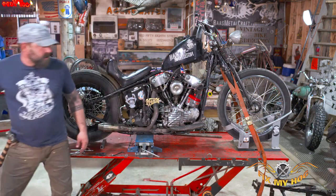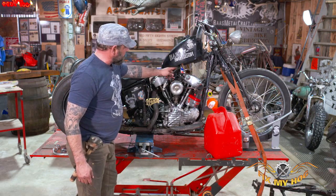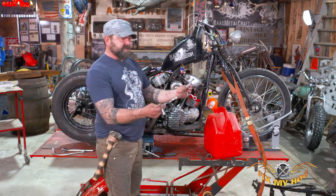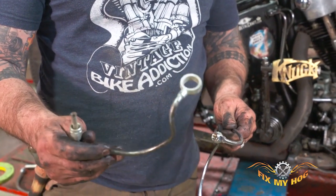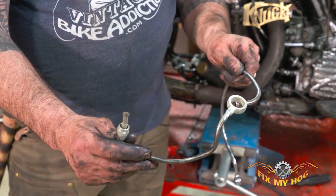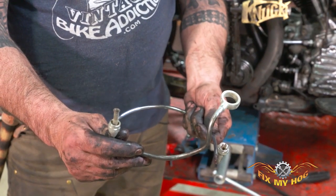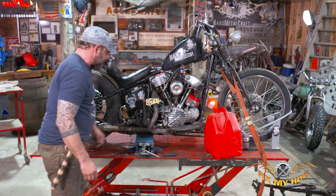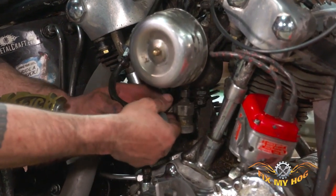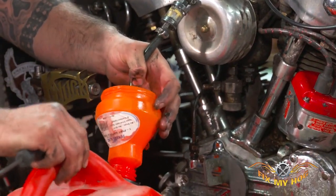So I'm going to grab my gas can here and put it up on my lift. Another thing to remember is it depends on what kind of gas lines you have. This one here is just some rubber hosing with some hose clamps. If I had a traditional stock-style gas tank, we'd actually have solid steel lines — that's how the old Harleys ran them, with a crossover tube connecting the left and right sides. So make sure you do your research to know what style you have. In this case, all I need to do is take my screwdriver, loosen up my bottom hose clamp to the carb, pull that hose clamp back carefully, and put the line in my gas can to let the gas drain out of the hose.